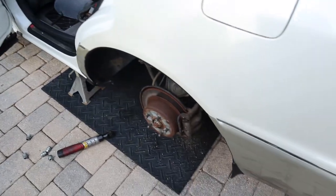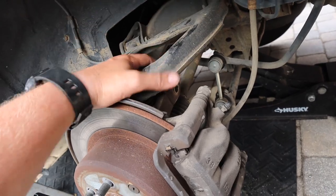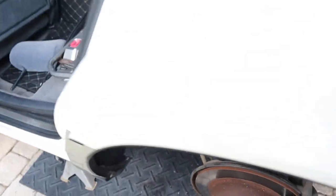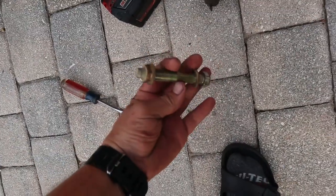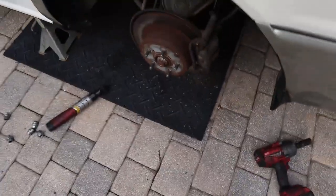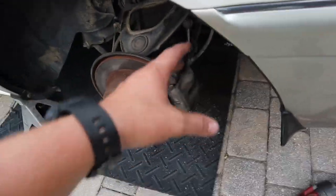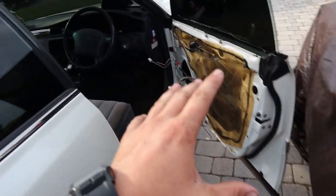The first coil is out - you saw the time lapse. It's super simple and easy. It's an independent rear suspension with a rear subframe, so all it is is one bolt on the knuckle and then three bolts that go up on the top hat - those were 14s and the bottom one was a 19. Pretty easy, just use the impact and it came right out. I actually had to jump on it to put some weight down because of the length of the stock strut - it was getting stuck on the boot. That was the easiest way to get it out.